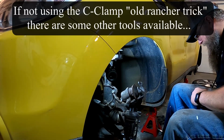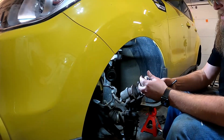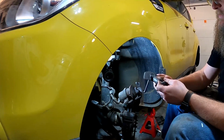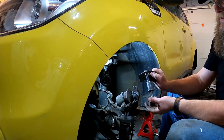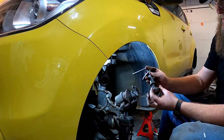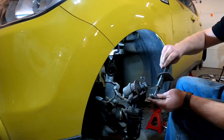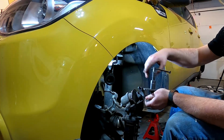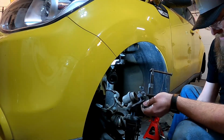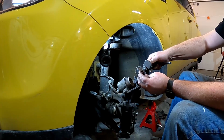There's a few different places you can get various tools. I've got a set that I use that kind of comes in 3 pieces. So I've got a screw, a thread, a little piece that we're going to push against. It's held on with a magnet that allows this to turn. If the other things need to stay still, it still allows my tool to turn. And then this piece just sets against the caliper to push things in, so you don't need the old pad.